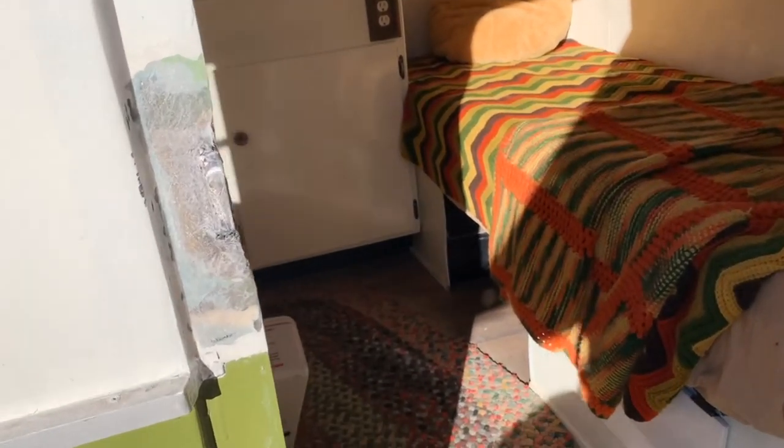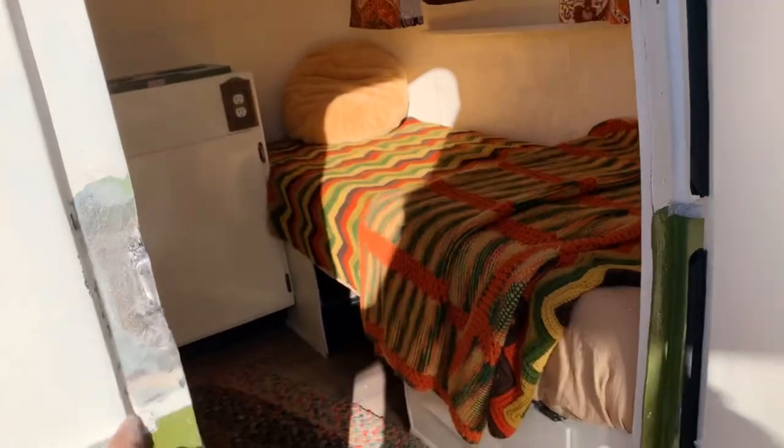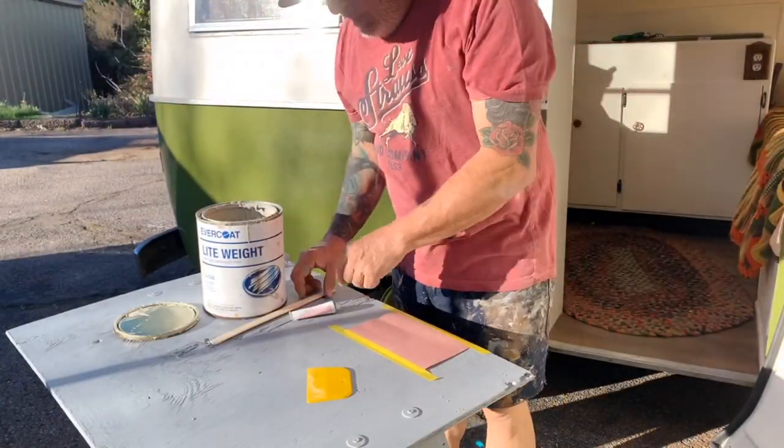I'm going to show you how it set up and dried. I went ahead and did a light sand — see that? Sorry about the shadow. It's all nice and smooth, so I'm going to mix up some lightweight body filler and put an application on. Then, depending on how smooth we can sand that, we may use some finishing putty before we do our prime, paint, and rolling and tipping of this area again. Alright, I'm going to mix up some lightweight body filler.